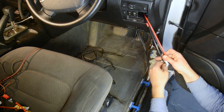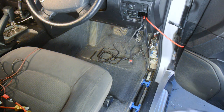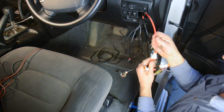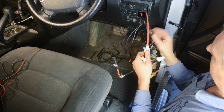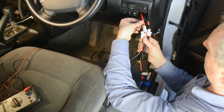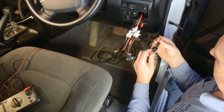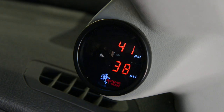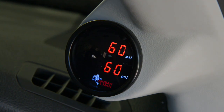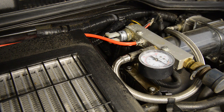You can then pull all the required lines and cables through the hole in the dash for mounting the paddle switches. You'll have a red supply airline from the compressor, a black airline from each airbag, plus the two pressure sensor wires from the gauge in the pillar pod. Connect the red supply lines together and the left and right airbag lines to the correct left or right paddle switch. Here's where the band of electrical tape applied earlier comes in handy, because you can identify which airline goes to the right side airbag. You should now activate the air compressor and pressurise the system and the airbags to the maximum 60 psi. Then spray all the air fittings with a soapy water solution and ensure that there are no air leaks.